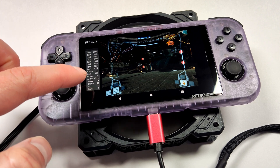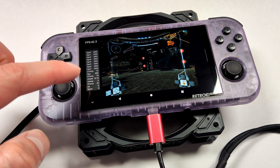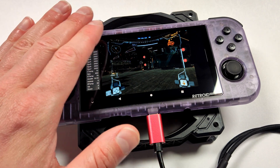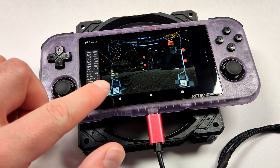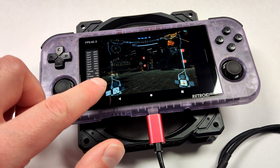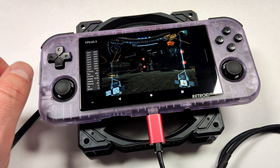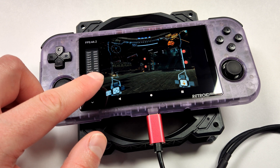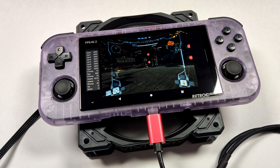With multiple tests run, the temperatures definitely cap out at around 72 or 73 Celsius. It's definitely still a little warm to the touch, but we've gone down from 85, so that's a nice bump down. I also don't see any CPU or GPU throttling. With a fan of this size though, I definitely thought I'd see better cooling performance. I think we're going in the right direction, so let's try the CPU cooler next and see how that performs.